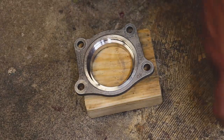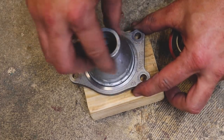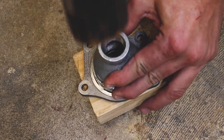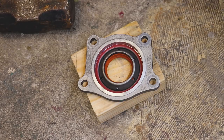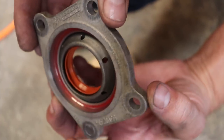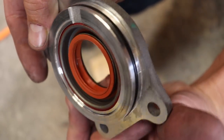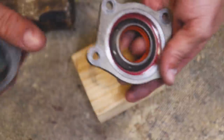I went to the hardware store and got a steel plumbing piece. I was hoping to find an end cap but I found a reducer and made my own installer. I degreased everything again with brake cleaner. That fits perfect — let's drive it in. Perfect — a little southern engineering for you. It's a one-and-a-half to three-quarter reducer, I just leveled the bottom out a little bit. Perfect installer tool.